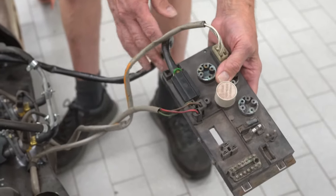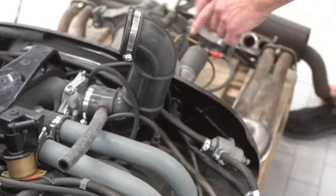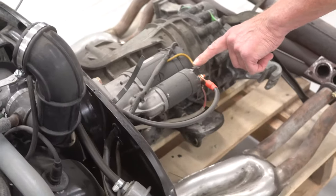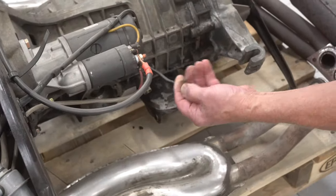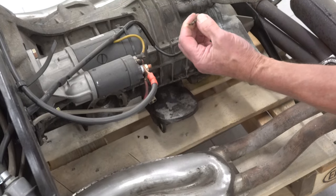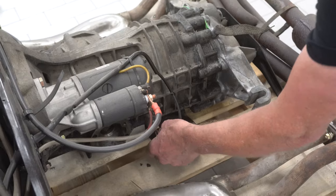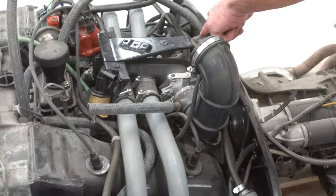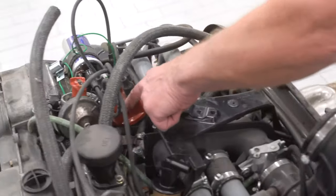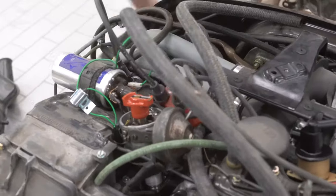This is the ignition wiring harness, which, besides going to the ignition, also goes back here to the starter solenoid — the yellow lead we talk about all the time — and actually the backup lights, which have two bullets that are supposed to be on them that often break off to plug into the backup light. Then the harness goes along the back of the engine, makes a dramatic right turn, and goes to the distributor, which is right here — that I've pulled out.